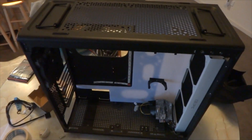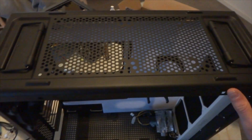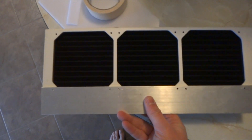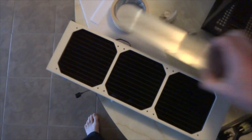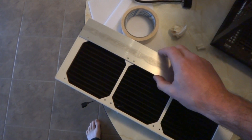What I'm doing now is mounting the top radiator. To mount it where I wanted to, I was either going to have to cut the whole top off including the handles and make a new panel, but I've decided to just make a bracket for it. I'm using these strips of aluminium I got from a local hardware store, cut them down. Here's one I prepared earlier — I've drilled the holes. Basically it's going to be mounted like that, and another one exactly the same on the other side, which will mean I can drill holes along here and get a little bit of extra spacing.